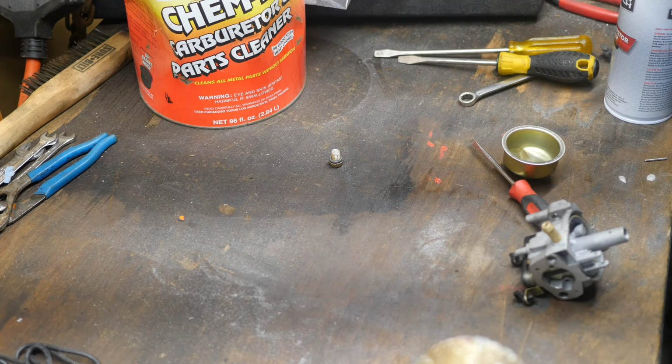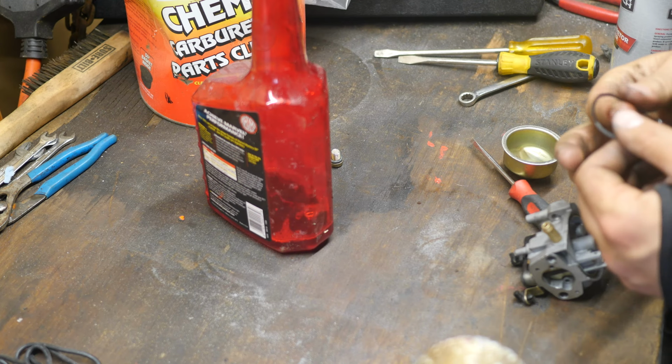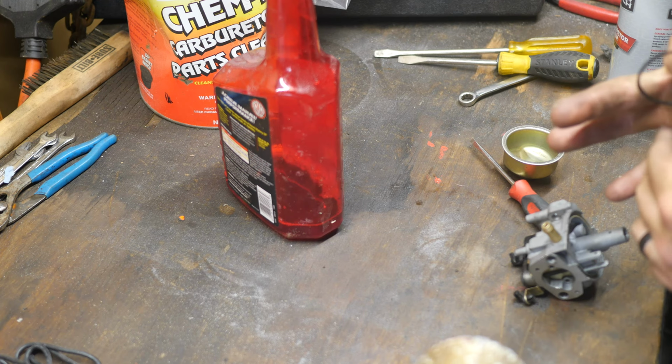I'm gonna go ahead and reassemble it now. That gasket's pretty well clean. We're gonna put a little bit of Marvel Mystery Oil. Two-stroke oil works good too. Marvel's my favorite to put on gaskets. I always put something on the rubber gaskets though, because it just kind of rejuvenates to some extent. Obviously a dried up, worn out gasket's not gonna just come back to life. It's done and will need to be thrown away, but this is still soft enough to reuse. Just putting a little bit of help on it.